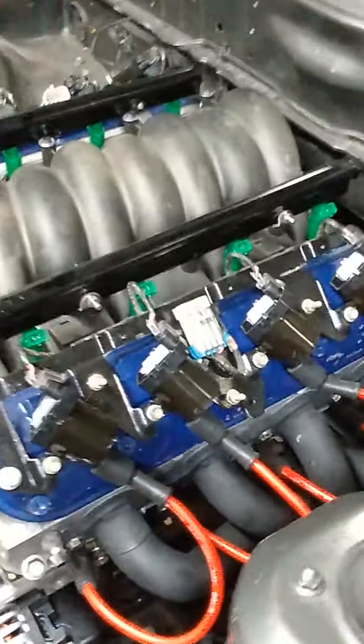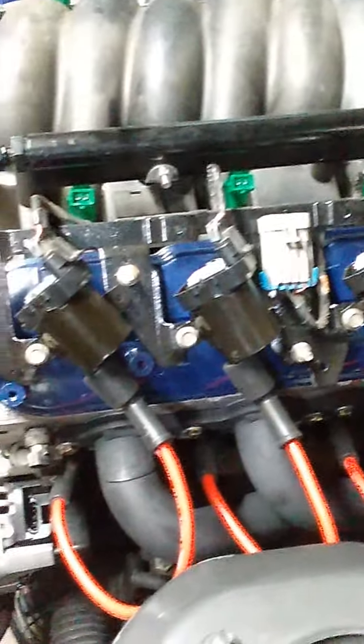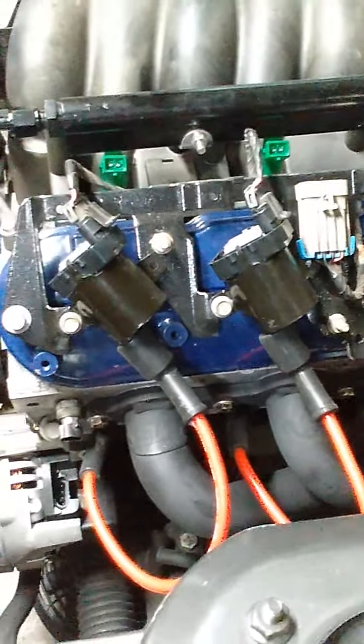Yeah, so then once we got that in, got the engine in there, got the intake manifold on, got all those bolts torqued down to spec, got the headers on with the new exhaust manifold gaskets, got those torqued to spec, and then I just started putting it together, opening up boxes. So I got all 8 coil packs, or ignition coils, all 8 coils, all 8 wires, and replaced the one broken plug on this side that I had.